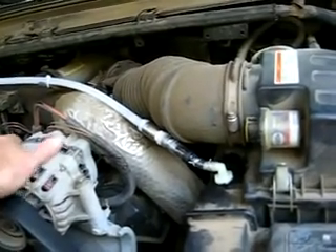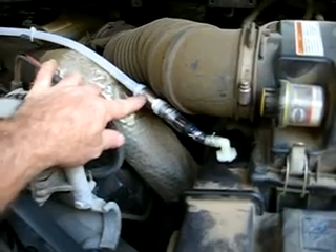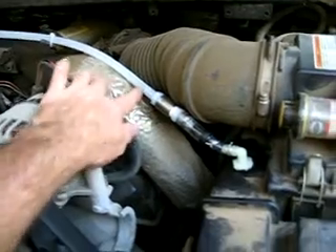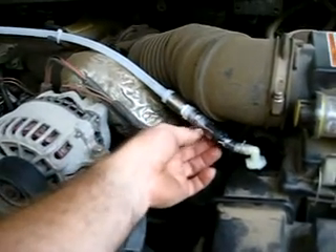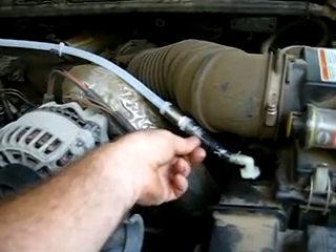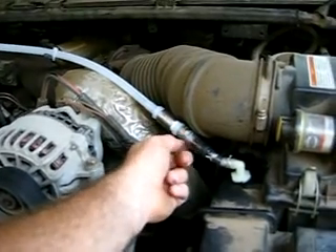In a diesel, I don't think I have to worry too much about flashback — not like you would on a gasoline engine. But I do have a PCV valve that I've used as a check valve, and this is a flame trap that I made out of a coupler to hose barbs. It's jam-packed with fine bronze wool. It's a positive crankcase ventilation valve — half inch on one end and three-eighths on the other. I had to telescope a piece of half-inch hose with three-eighths hose, which made a nice tight fitting. I also took stainless steel wire to it just to make sure.